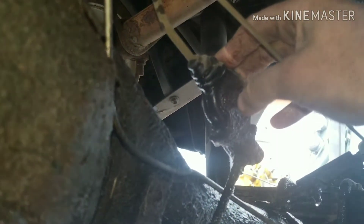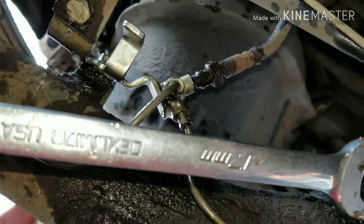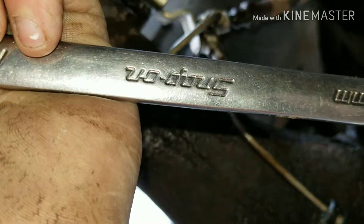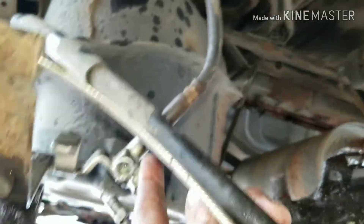This is your height or ride sensor for your brake lines — you have to take that off. Make sure you don't break that. For your brake line here, you want to use a 17mm wrench to take that line loose from the main hose. You might have to put a pair of pliers on the brass fitting. On mine, I took the bracket loose so I could get this loose without twisting my line off.